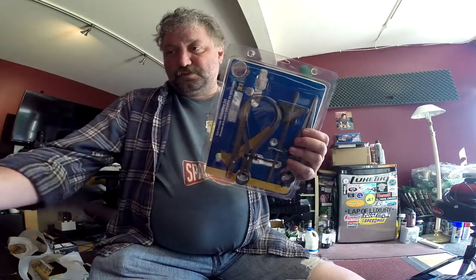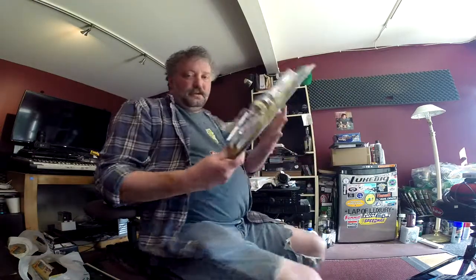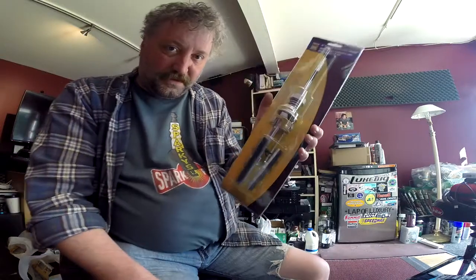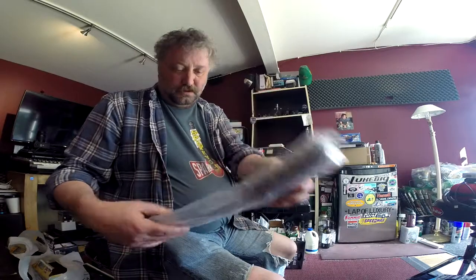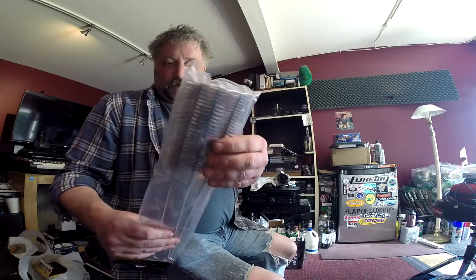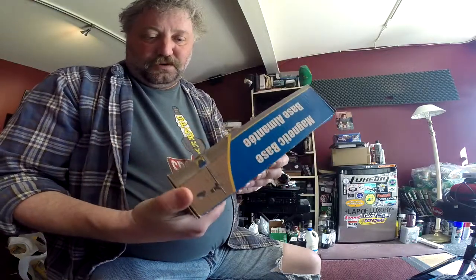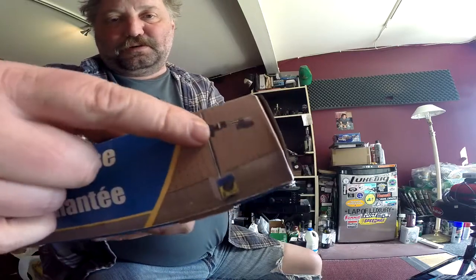Anyway, I don't like the measurement I got there — I think it was 4.250 or something like that. I don't trust some of those numbers. They didn't have a dingle ball style hone, but they did have this one which goes from two inches to seven inches bore. Just as good — it's got honing surfaces and they'll do a similar job. I just happen to like the look of the dingle ball ones and the name. Aluminum brushes for cleaning out the passages. A few of these will match some of the holes on the block that we need to brush out. And then a magnetic base which holds the dial indicator in position while you're taking measurements. This will also come in handy to hold the GoPro — you can put it down on any magnetic surface and position the camera or indicator wherever you want.